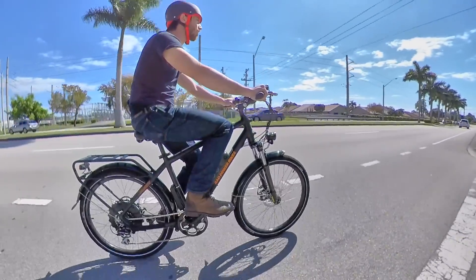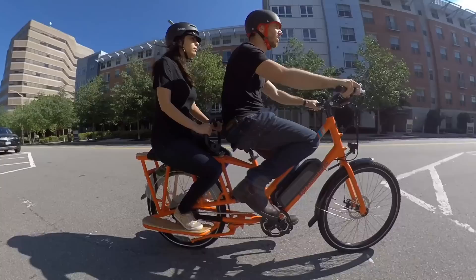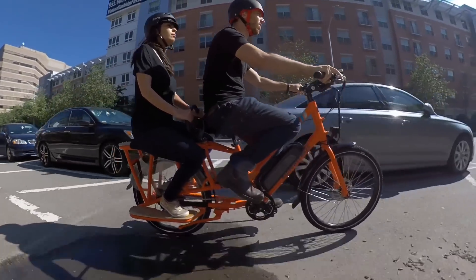So there are more expensive parts that go into creating an e-bike that can handle regenerative braking — you need a BMS and a controller designed to do this safely. There are bikes that do that: the Rad City is one, and the Rad Wagon used to, but they're switching to a new geared motor so they don't anymore. There are other bikes out there that do regenerative braking, but they're becoming a lot more rare for these reasons, as so many bikes are now using geared motors which don't allow it.